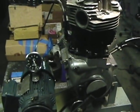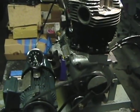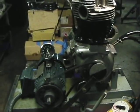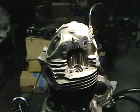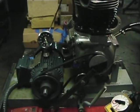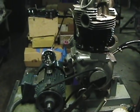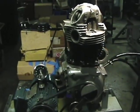Well, here we are — one more hour. The first half hour was at 6,500 RPM, then I decided to push it a little more and the last half hour has been at 7,500 RPM. Oil and barrel temperatures are over 200°F now. As soon as things cool off enough to touch, I'm going to pull the barrel off and have another look at the lifters.